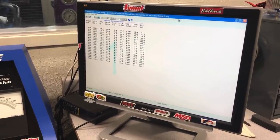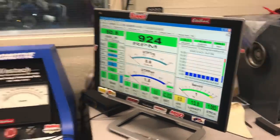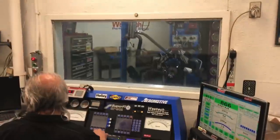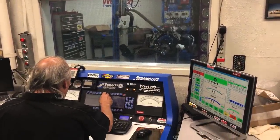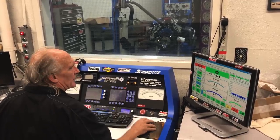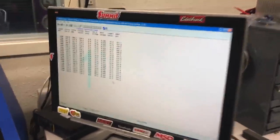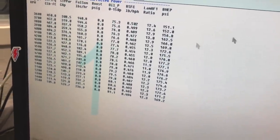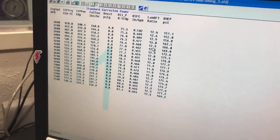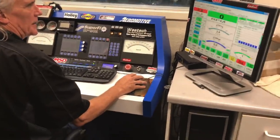You could almost go back in and pull out another two or three jets out of the front — maybe two. So what's the air fuel now? From a half on the throttle, it's low 12s. It goes from mid 12s as high as rich as high 11s. But as lean as high 12s or 13. So it's going to be hard to get that dialed without affecting it somewhere else.